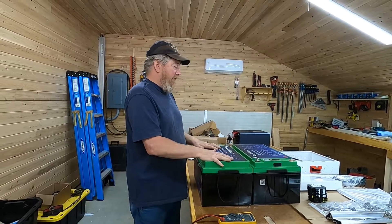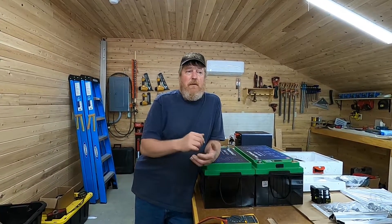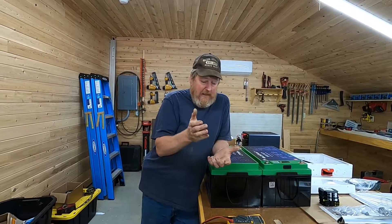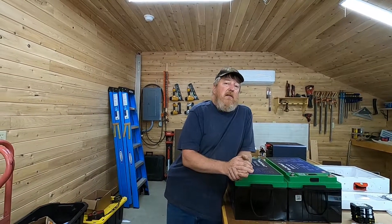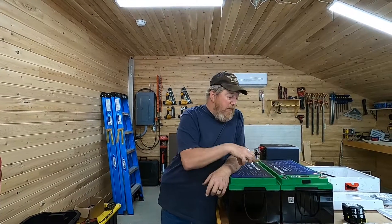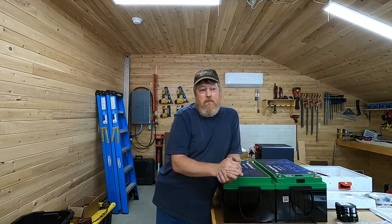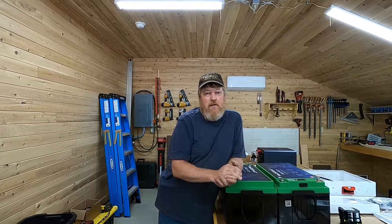For this golf cart we might get away with three or four lithium batteries, but it would still cost a tremendous amount more than lead. This 300 amp-hour 24-volt lithium battery to power that same size inverter would run you probably close to $4,000. You saw our camper video — we've got six lithium batteries in there, almost $6,000 in batteries, whereas we could have put in a handful of golf cart batteries for five or six hundred dollars, though they'd be heavier and require maintenance. Long term I think it all evens out because lithium lasts so long you'd go through several sets of lead-acid.